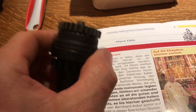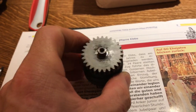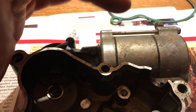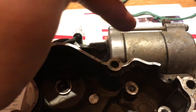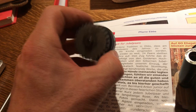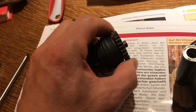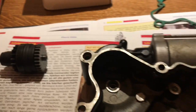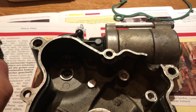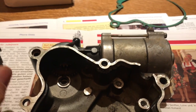I've done a bit of maths on the gearing: from 18/27 to the newer version with 16/28 is about a 17% increase. Then if you do the next mod — I'm going to replace this 350-watt motor with a 410-watt motor — that again is another 17%. Put those two together and you get about 37% more starting power. It makes a huge difference, especially if you've got a modified head on a 300.